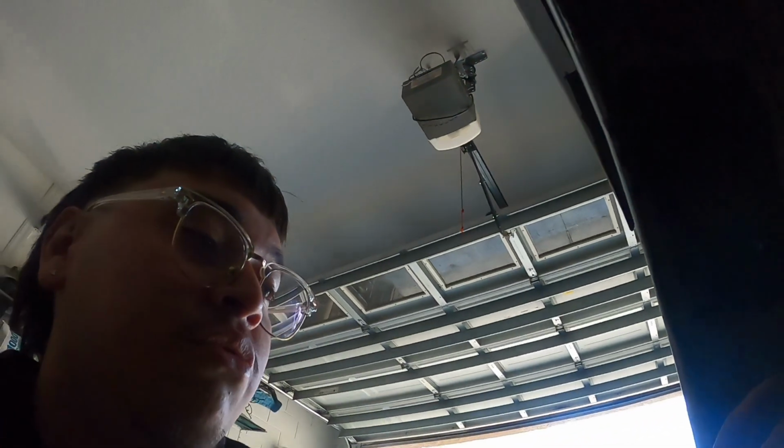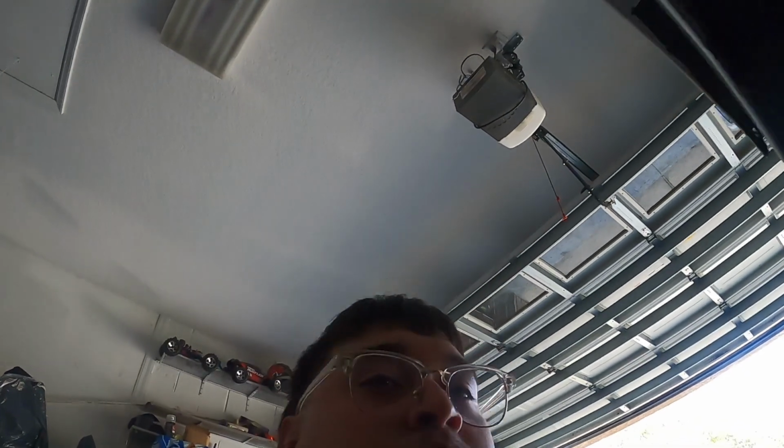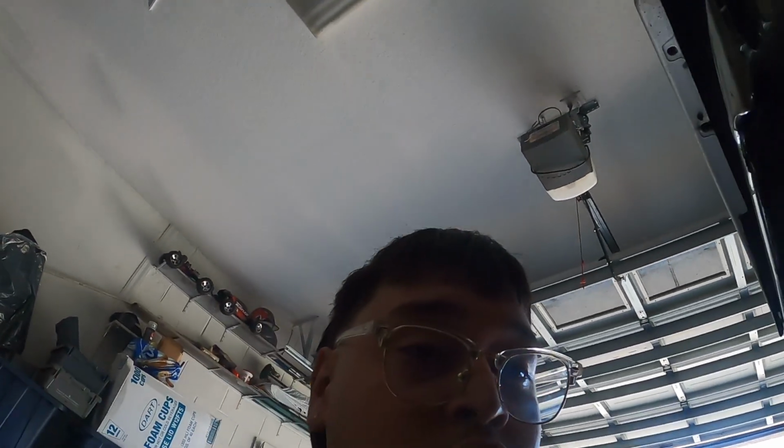Also for the rear end, we have the diff raisers and the subframe risers. I also recommend those if you go this low, or if you're gonna go with this amount of camber, so you have less axle bind. Also, I just cut this out, but this is gonna end up getting tubbed later on, just so I don't do it a little shitty. I just wanted to test things out real quick before I actually do them to the car. And as you see, they work perfectly fine.